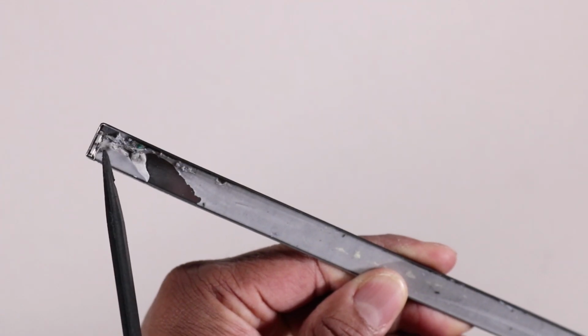Replacement. Note, the display panel chin plate has 2 metal tabs on each end that slots into the opening at each end of the display panel cover. Carefully insert the metal tab on the one end of the display panel chin plate into the display panel cover. Carefully press the display panel chin plate onto the display panel cover. Insert the metal tab at the other end of the display panel chin plate into the display panel cover.